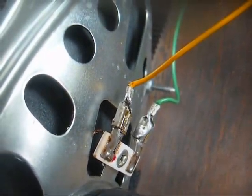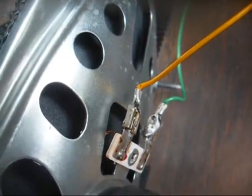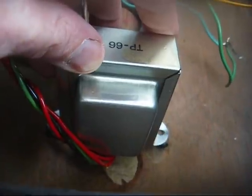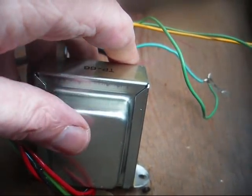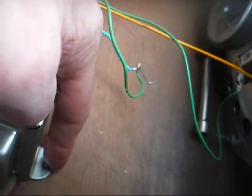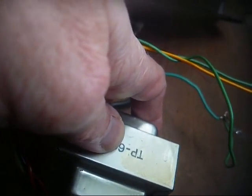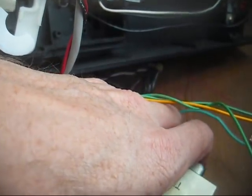On the speaker, you can see where they used quick connect terminals, but then they sloppily soldered — especially that bottom one — the terminals in place so you couldn't just slip them off. They didn't even get the screws in here correctly. That's the reason the transformer was only held in by one screw — they have the screws spaced too far apart. They tightened the nut down and washer over this one to hold it down, but after 25 years that worked loose and caused the transformer to be flapping in the breeze under here.